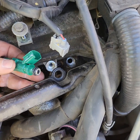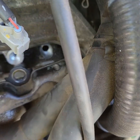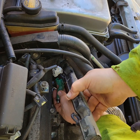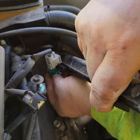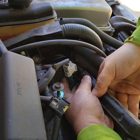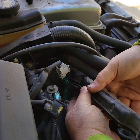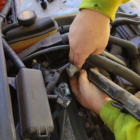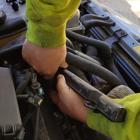We're going to start back here with this one. These notches right here in the fuel rail tell you exactly where the fuel injector goes on the other side — so that's a nice indicator. You know that the part of the injector with the wire has to be on this side, and you know you're going to slide it right in underneath. This is the most difficult one to do — and it's in.